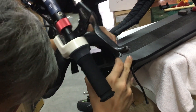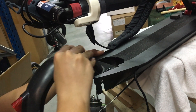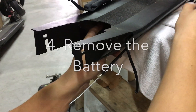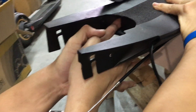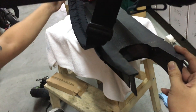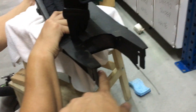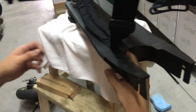Gently shake out the rear fender and slide it out. Remove the foam pads. Keep pushing the back because the battery sits very tightly in the deck — push it back and forth until something comes loose. Sometimes if it doesn't come up from the back, you can push it up from the front. That's why we need to open up both the back and the front end, just so that we have space to push it in and out.